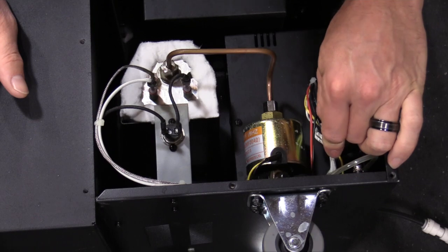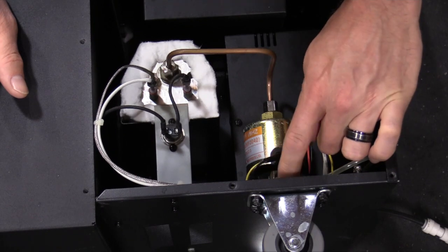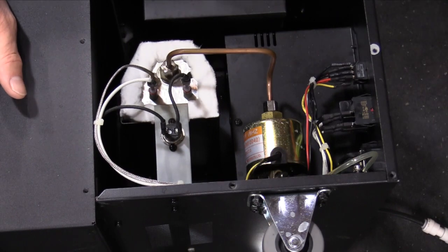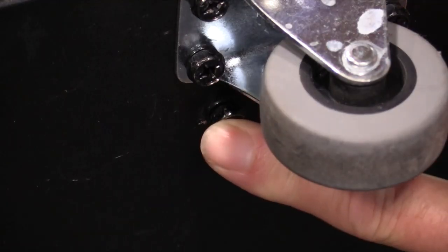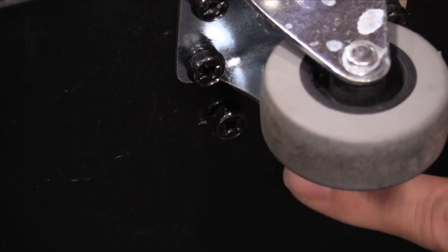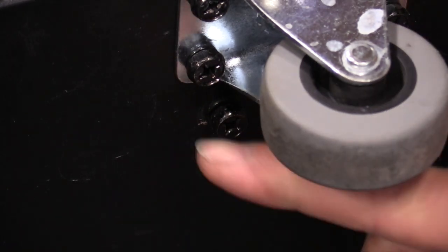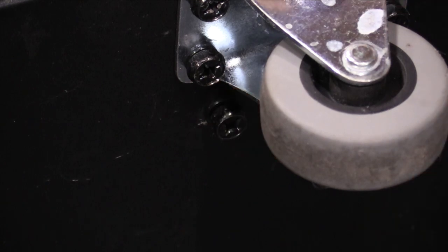I might have to clip some of these cable ties in that. So let's get started. There's 2 large screws that hold the pump into place. There's one right here and one you can't see. It's wheels blocking it. I want to pull these out, but before I do that, while the pump is stable, I actually need to disconnect that copper line. So I'll do that first.